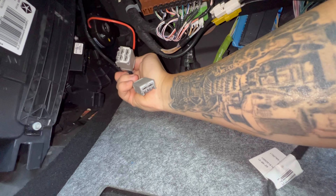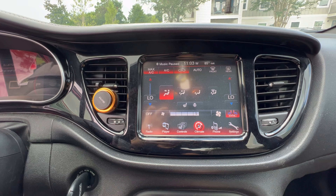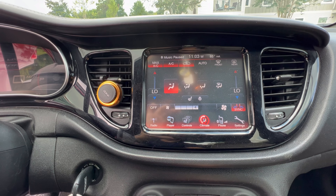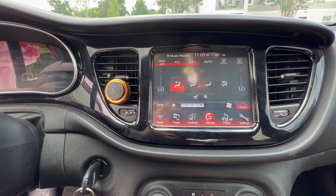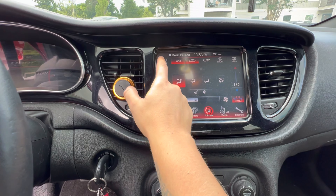I just wanted to show you real quick — this cover is made for this specific model of blower motor. You don't need it for your new one. Just for clarity, it doesn't fit on the new one because the new one already has its own cover. Now we're going to install our new blower motor. This did take a lot of wiggling with one arm, but it was fairly easy to get in. We're just adjusting the holes to line up so we can put our bolts back through. The orientation of the red and black wire needs to be at the 12 o'clock position instead of the 9 o'clock as shown here.